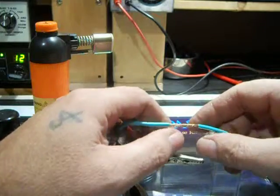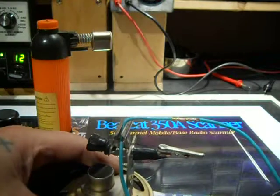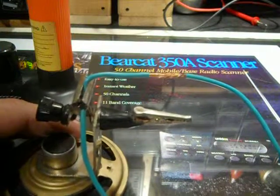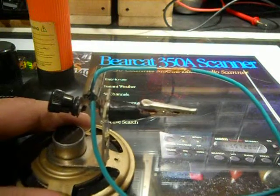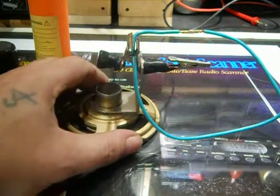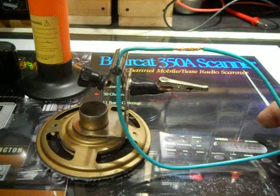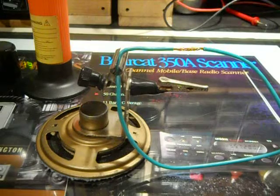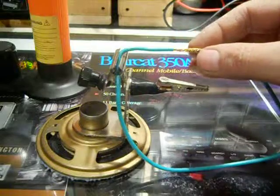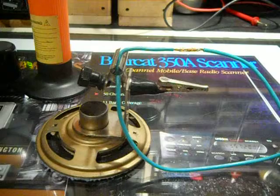See how I'm twisting this together. That's the proper way I was taught — shove it together like that. Don't do that X-over like that. Please don't do that. If you've ever had to tear apart stuff where people have done that, you just get a big wad trying to pull it. See how nice — this is smooth, just like the wire, it's the same diameter. When you put heat shrink tubing on, you've got a good splice.